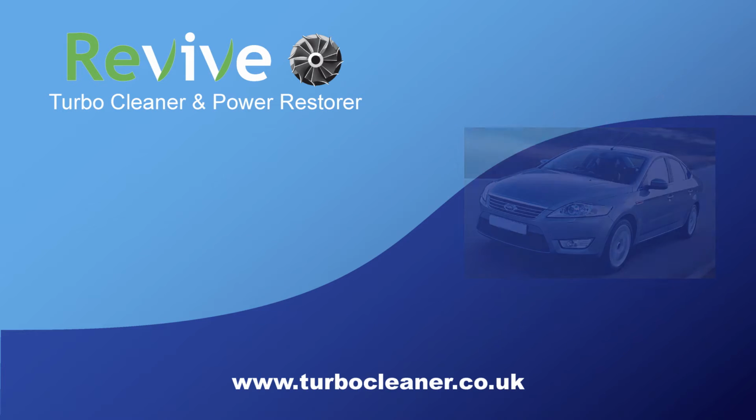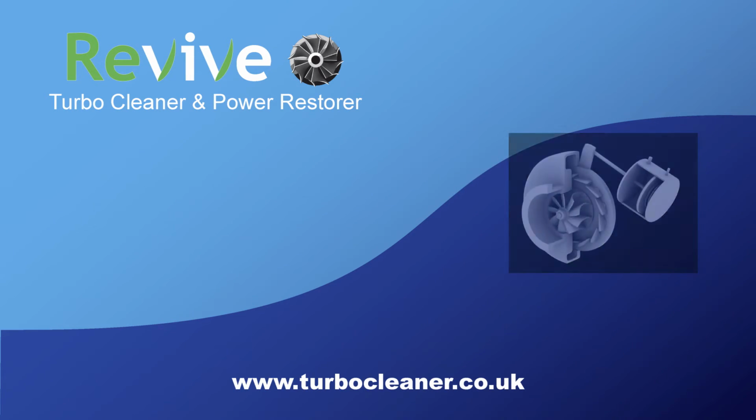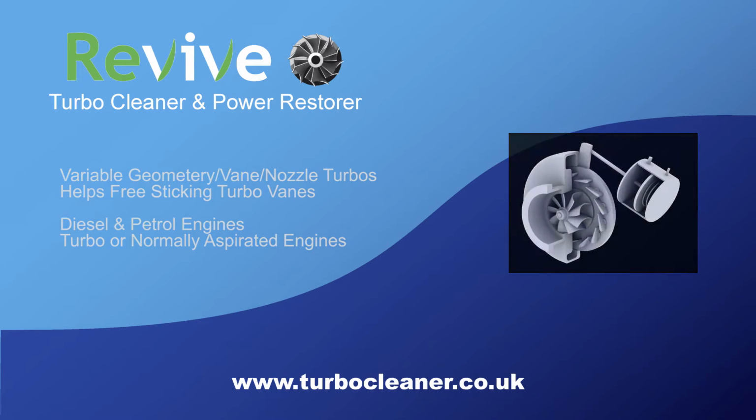The car we are performing the Revive clean on is a 2007 Ford Mondeo TDCi. When the car is being driven with the engine under load, the power keeps surging and dropping off in a cycle. Revive works well on diesel vehicles that use variable nozzle or geometry turbos, as the vanes inside these tend to stick when deposits of carbon build up around them. Revive can also be used on standard turbo, non-turbo and petrol engines.